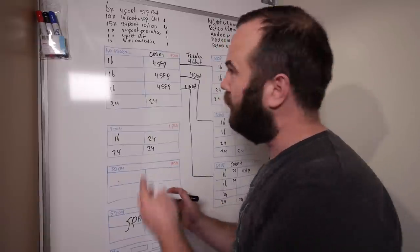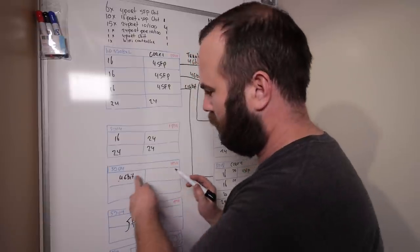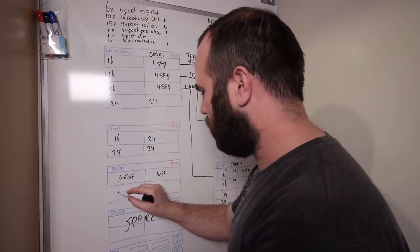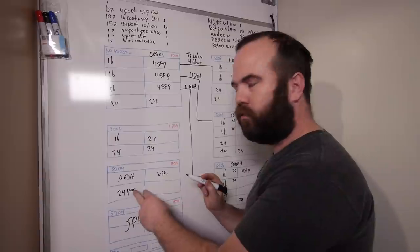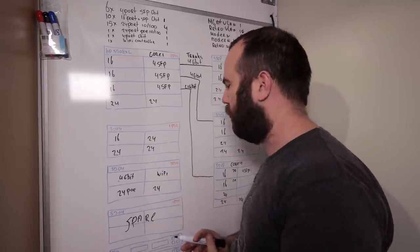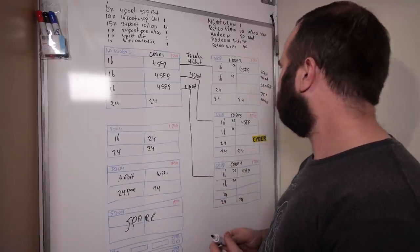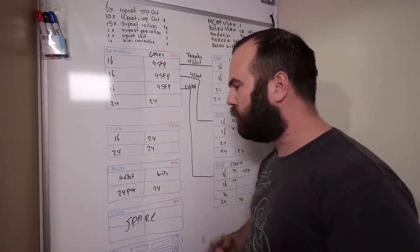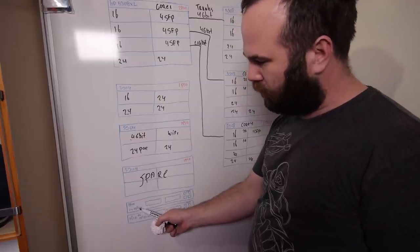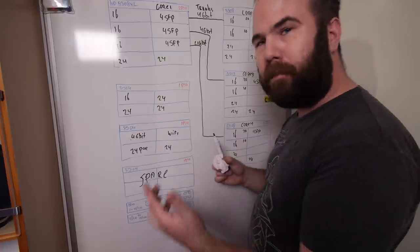So it is good to have an extra one with a lot of ports. Then we have this switch where we are going to put all the extra cards. It will get the 4-port gigabit RJ45 so we can make a 4-gigabit trunk or just a 2-gigabit trunk. It will get the WiFi module, the 24-port Power over Ethernet 10/100 to run the access points, and the leftover 24-port blade for extra 10/100 ports. I also have 2 HP 2610s with 24-port 10/100, 2 RJ45 gigabit, and 2 SFP modules.